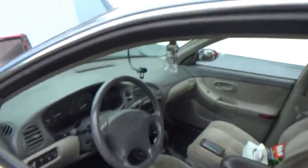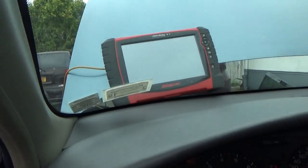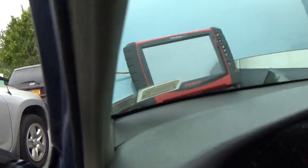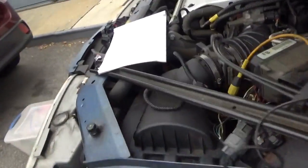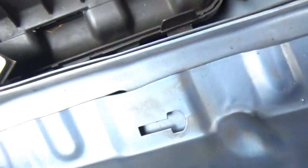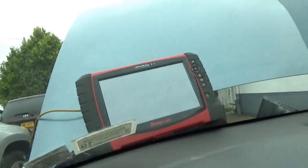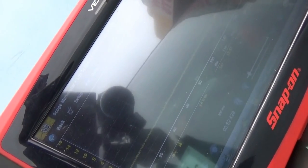Push on the brake pedal — nothing's happening on this wire. Let's see if the brake lights work. There we go — let me see the scope jump. Off, on, off, on. So that is our brake pedal switch signal wired into the RPM pin. Those two white wires are swapped and we can flip them around, which will get rid of two codes. However, the steering wheel position signal is missing entirely — it's not installed in the car, so the module is actually wrong for this vehicle.